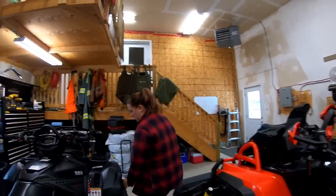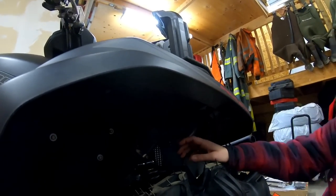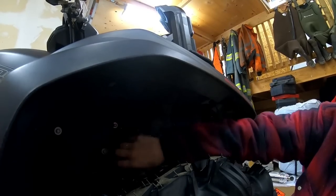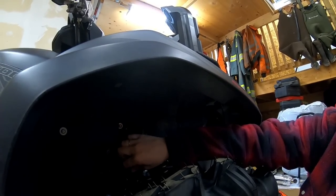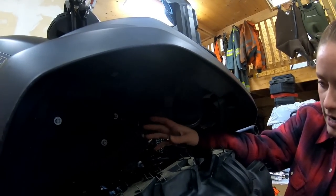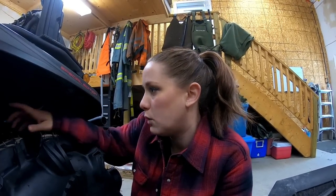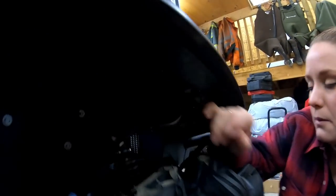One last thing about the tires. Because we did the snorkel kit and the rad relocate, the snorkel tubes are routed in the front fender here. So initially there was some rub. Kyle kind of positioned everything. There's no rub right now, but if the suspension comes under any kind of pressure, it would potentially rub. So we're just going to stiffen up the front suspension.